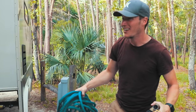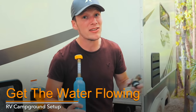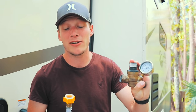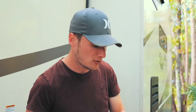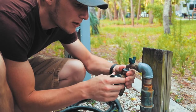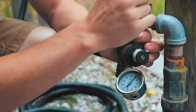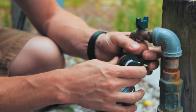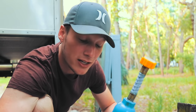Now we're getting the water connected. A must-have is a water pressure regulator. You don't have to get this model, but it allows you to make adjustments at the spigot. Put it immediately on the spigot so you know you're only putting the PSI you set — sometimes the PSI coming out of the spigot can blow a hole right through the back of your RV. We also have a water filter on, which is really nice — you don't know what kind of water supply they have, so it's definitely recommended.